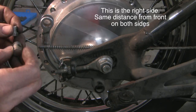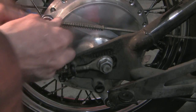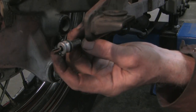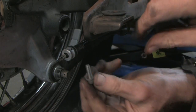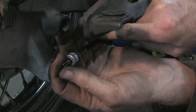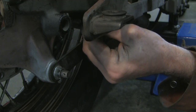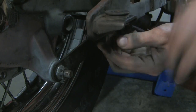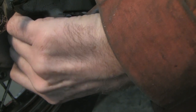Here's the speedo cable right here. When the speedo cable is in the correct position, the retaining nut sits in that groove and holds it in place. If you can't get it pushed in properly, just rotate the cable itself and the forks will mesh with what's inside. If you're still having trouble you might lubricate the O-ring. That felt like it went in - and then you just tighten up the retaining nut. Needless to say this wouldn't be a good one to cross-thread, so be real careful. No air tools until you're sure you're in the right threads.